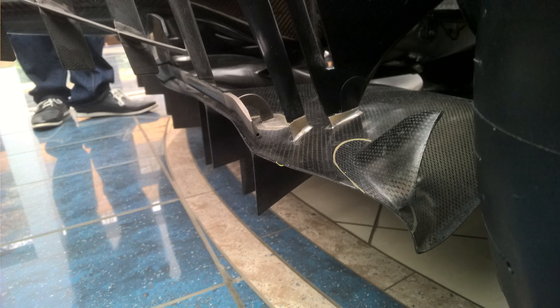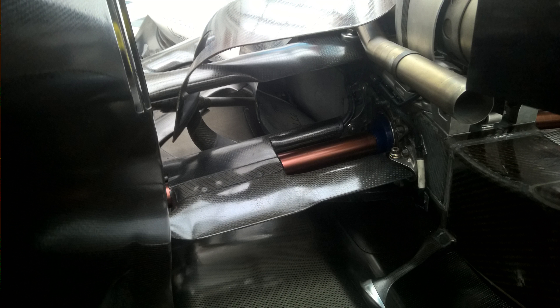In this photo, you can also see the multi-element gurney flap — these are all over the F1 cars. Here's a shot of the rear control arm. You can see the driveshaft sticks out on the inside but is then shielded in the outer section by the control arm itself. It's a pretty cool level of engineering going on here.